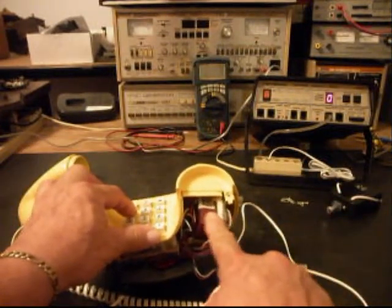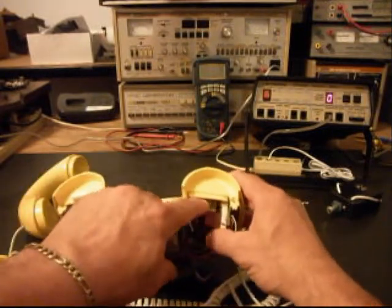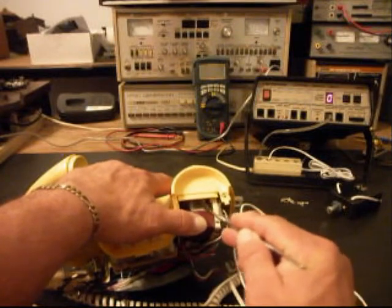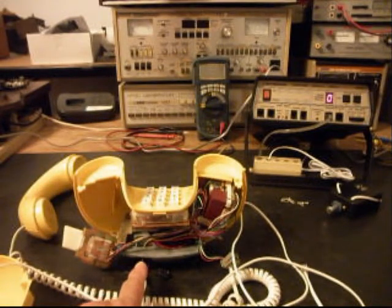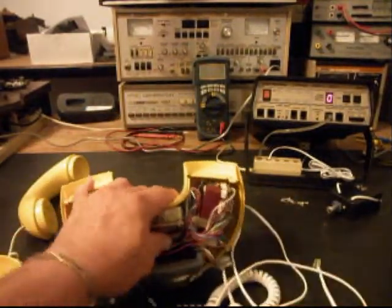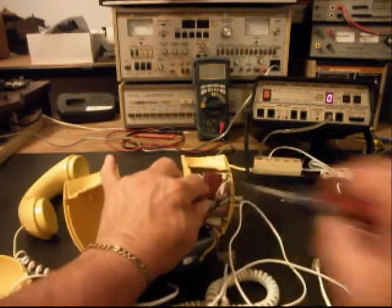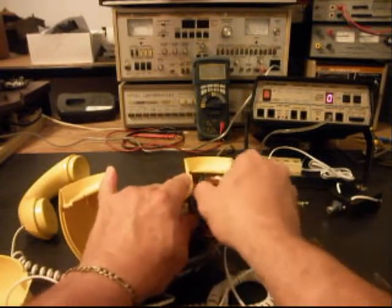This telephone's been dropped, and I know that it's been taken apart and a cord installed. But if you look at the transformer inside this telephone — I'm going to pull it out — this telephone, even if you did get the connections proper, would never work properly because the network is broken. What we're going to do is pull this network out and show you what we're talking about. It's a pretty serious problem because if this network can't be repaired, we're going to have to replace it, and the networks are not that easy to find.